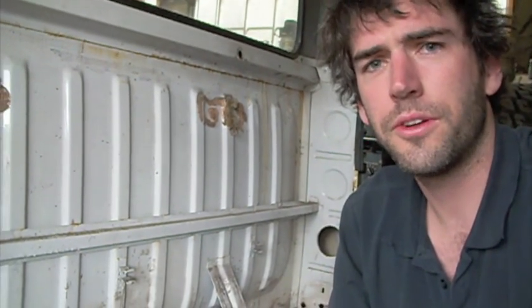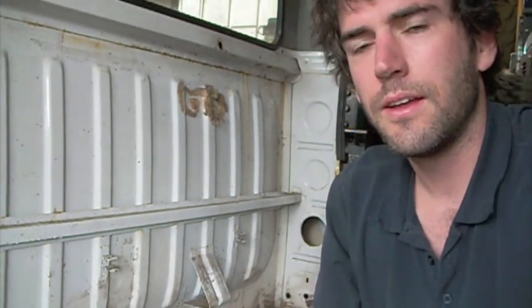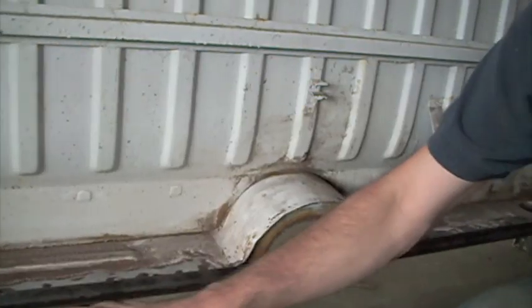I had a suggestion from one of the boys on minitruckin.co.nz about bracing the cab when I'm cutting it out — it was a good point. I wanted to cut off some of this bit under here to make clearance for the chassis rails, so we've welded in this brace. I've put some more reinforcing in — this is going to be the back portion of the floor. Once I've got it fully welded in, we'll cut this out and do the sides. Excellent point, very important — don't want it getting out of square.